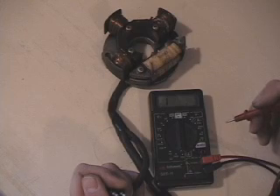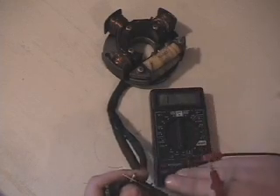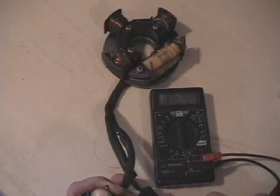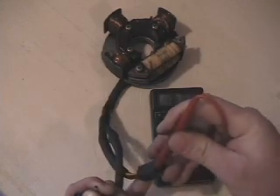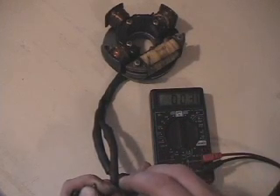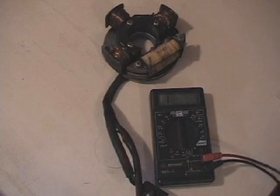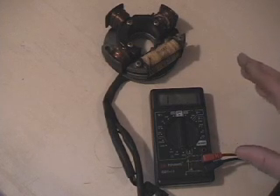The ground wire we can check for continuity real quick too. Positive and negative don't matter — just run one lead over to the negative plug on the four-prong side. We get 0.4, so we have continuity. On that four-prong plug you've got your two power wires, your ground, and the one other connector. So that's how you check a 1994 ZR580 stator. A lot of the early-90s carb stators — the 700s, 500s, 400s — are very similar in design, and usually the only thing that varies is just the ignition coil values.